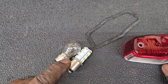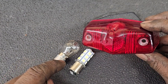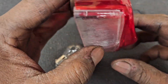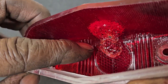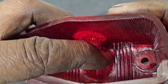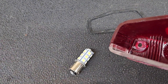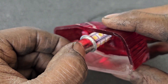While the LED will absolutely not lead to the incandescent bulb having melted your taillight lens, the problem is now that the actual incandescent light bulb has melted the lens already. On the inside you can clearly see where the melting has done some damage — this part here is actually kind of crusty. When the LED light goes in to take the place of the incandescent bulb, it actually presses right up against that melted part and won't physically fit.